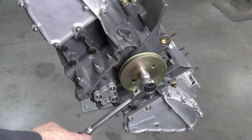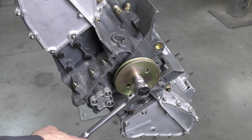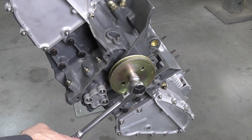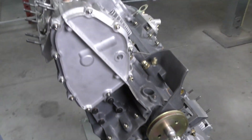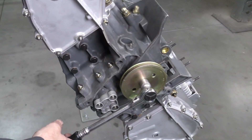When installing the rockers, the rockers need to be on TDC — top dead center compression — of whatever cylinder you're working on. You can jump back and forth from side to side, but I usually like to do one side, get the covers on, and then do the other side. So I'm going to follow the firing order, but it's every second cylinder.